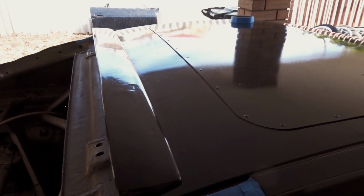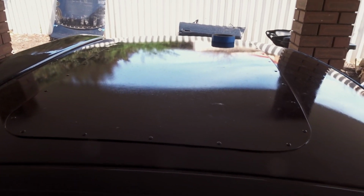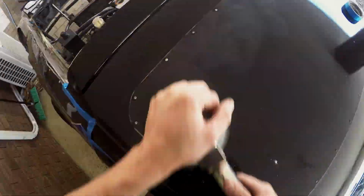Because the roof is still nice and straight, it's not going to need any repairs, so all we need to do is just do a quick key coat over it, and then it'll be ready for some primer, because the new paint does require a white base and it will just look terrible with the black base, and we'll end up using a lot more paint than we actually need to. Before we lay down primer, everything needs to be scuffed up so that the primer will stick.